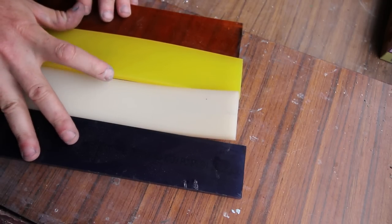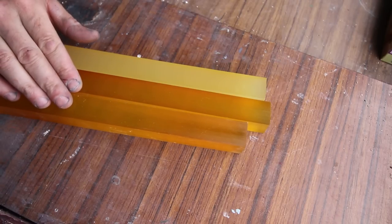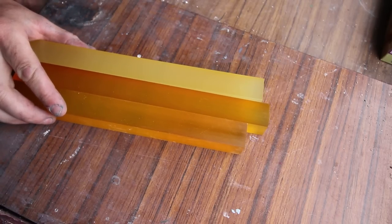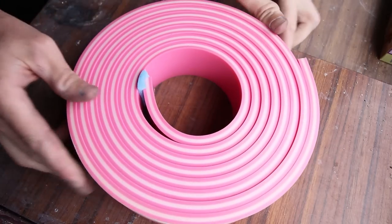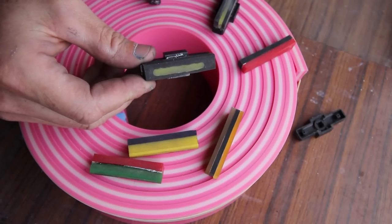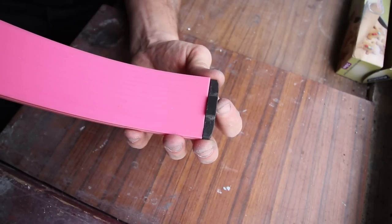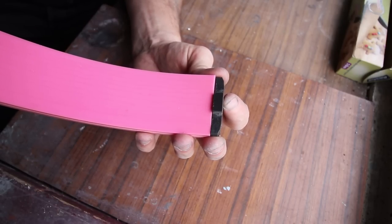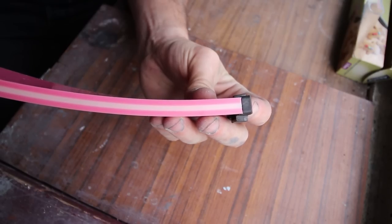The tricky thing is that not all chemical blends are the same, and there can be wildly different brake performances from polyurethanes that claim to be the same durometer. For example, these are all the same durometer but all gave different brake performances, with some working well and others feeling a little waxy. Generally I found transparent polyurethane to work okay but can lack hold — it seems to shave off on ground rims and then roll on these shavings like bearings. This one is pretty interesting: it's 80A sandwiched by pink 90A. Experimenting with different durometers in a single pad has been something I've tried, and I think there's a lot of potential here. It also comes in a 50 by 10 millimetre roll, which makes the pads a whole lot easier to make. I'll link to some of my favourite material in the description, but if you want to experiment then feel free.